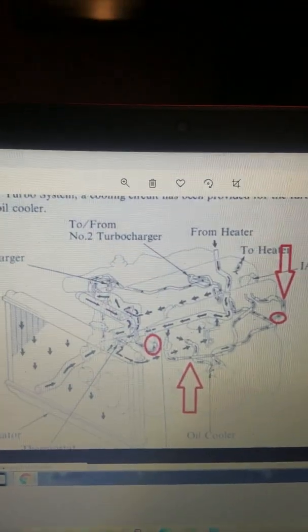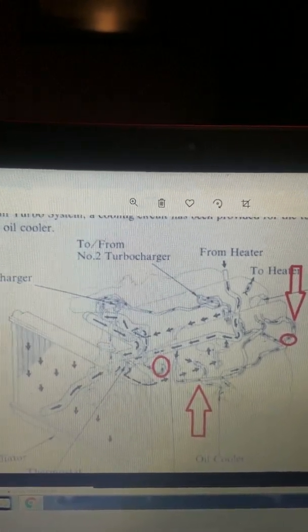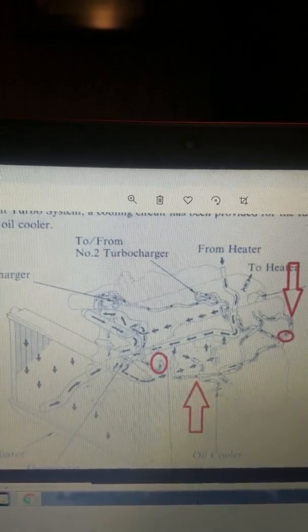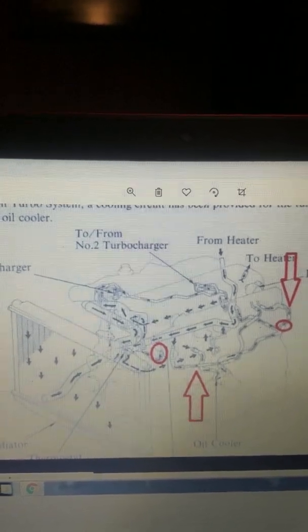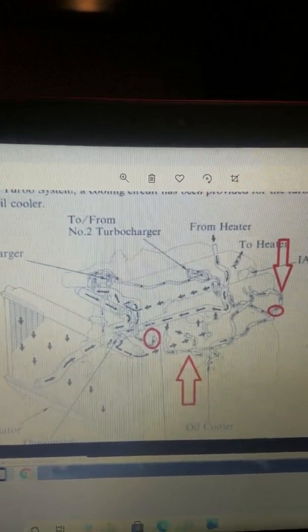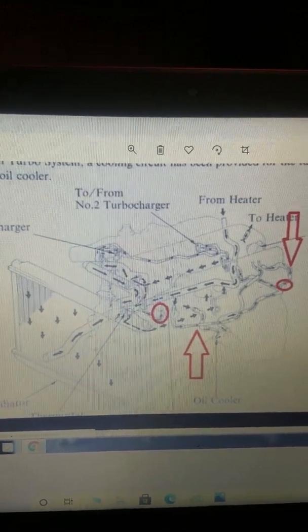Why did I have this in here? This is the coolant flow chart for the JZ engines. I'll go ahead and sit here for a minute in case anybody needs this. I was just putting this out here because I actually was able to remove the oil filter cooler thing to add the oil cooler only from the 7M engine. And I have the coolant passage plugged up on the block like the normal GE engines do that don't have that extra cooler. And it runs just fine.